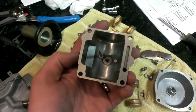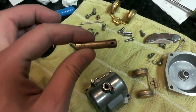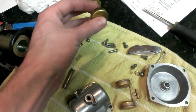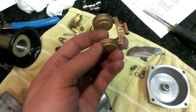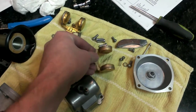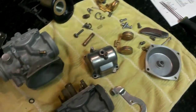Here's the float bowl — see how clean that came out. Here's the needle jet, and all the holes are clear and all the threads are clean. Here's a new set of floats to compare, and here are the ones that got cleaned — still a little bit of crust on them, but I don't feel anything on them and nothing rubbed off. Everything came out really clean. I'm really impressed with it.